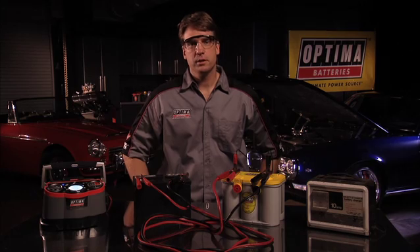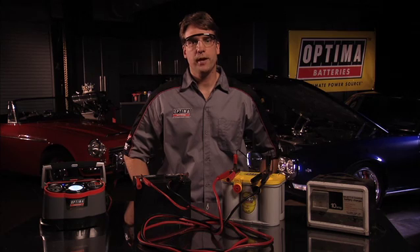When the battery has been deeply discharged, some sulfation of the battery plates may have occurred. If you charge at 10 amps, the higher current will help break up the sulfation. After you've hooked up the battery charger, let it charge for two hours, monitoring it frequently.